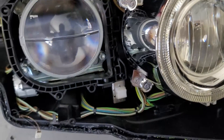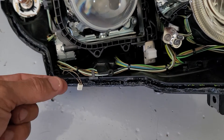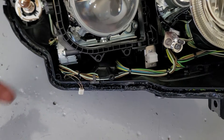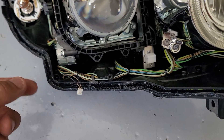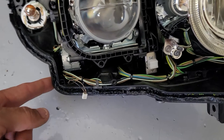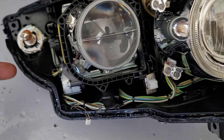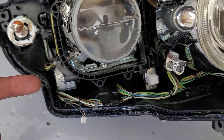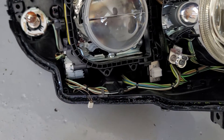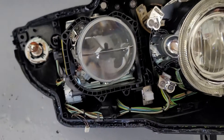You can take this headlight completely apart and try to apply either heat shrink by removing connectors and sliding heat shrink over the existing wires, or splicing in new sections of wire. You can also use liquid electrical tape and paint that on — that might get you a temporary semi-permanent fix.